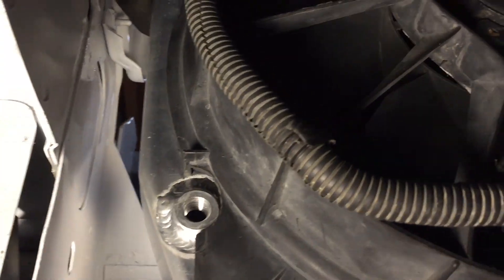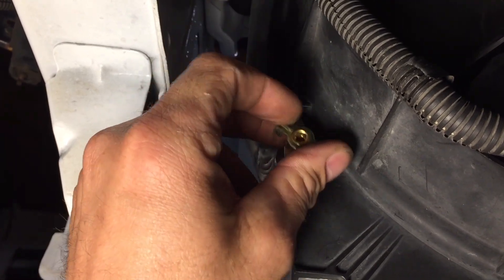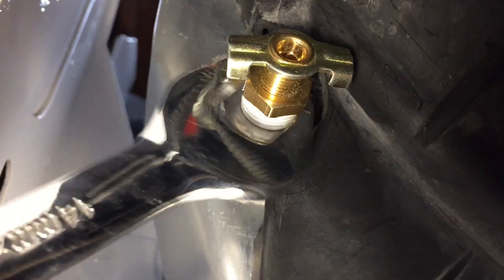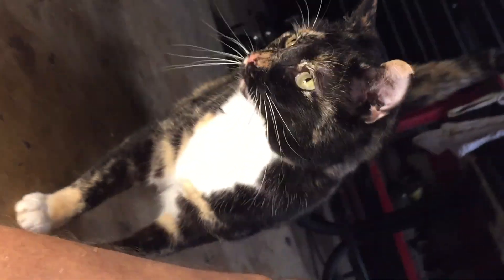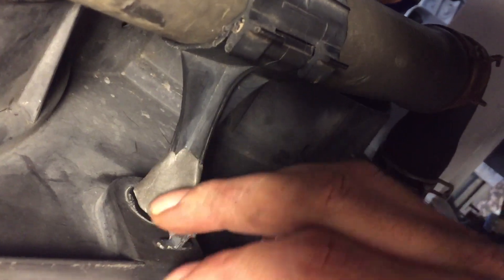I'm about to put the petcock valve in the radiator - I never put it in when I installed it, kind of forgot about it. I was just under there tightening up all my grounds. Oh look at that, it just fits - perfect! Also, the steel stick I used on my coolant hose mount where I cracked it - I packed it with steel stick and it's probably stronger than it's ever been.